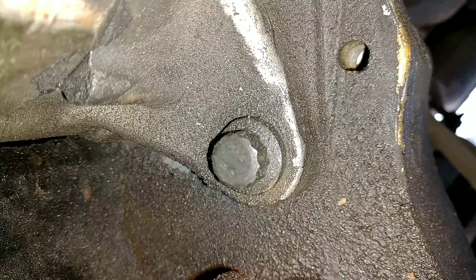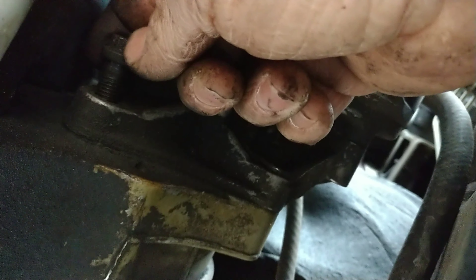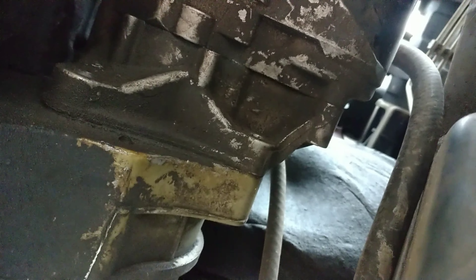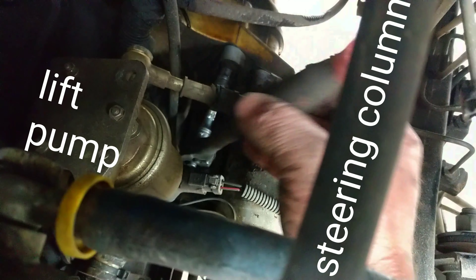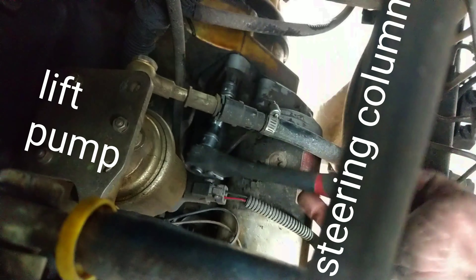I don't have that kind of bit. There are two of these bolts on the bottom — one right there, one directly above the transmission cooler lines. There's definitely more hiding so I'm gonna find out where they are. Beneath the fuel water separator, past the lift pump, there's one bolt on the top end of the starter — it's super fun to get to.